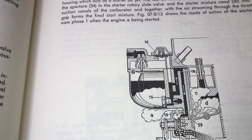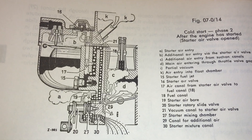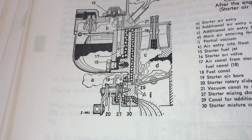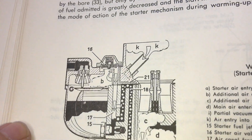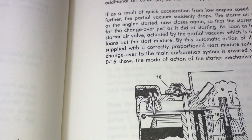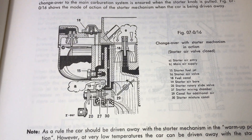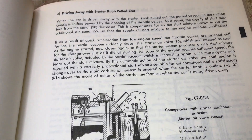So this is part of the choke, which is what I'd mentioned earlier. I know it's not the choke, but it's part of the choke. You can see the passageway indicated here of the air going into the passageways. Here's number 16 again mentioned, same passageway. And over here, driving away with the starter knob pulled out — that's number 16 with no air going through the passageway. I hope that helps you out.